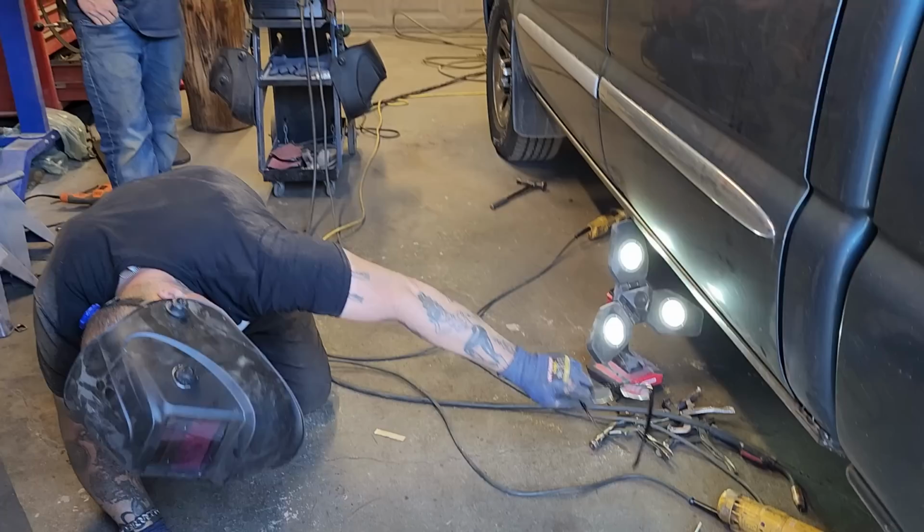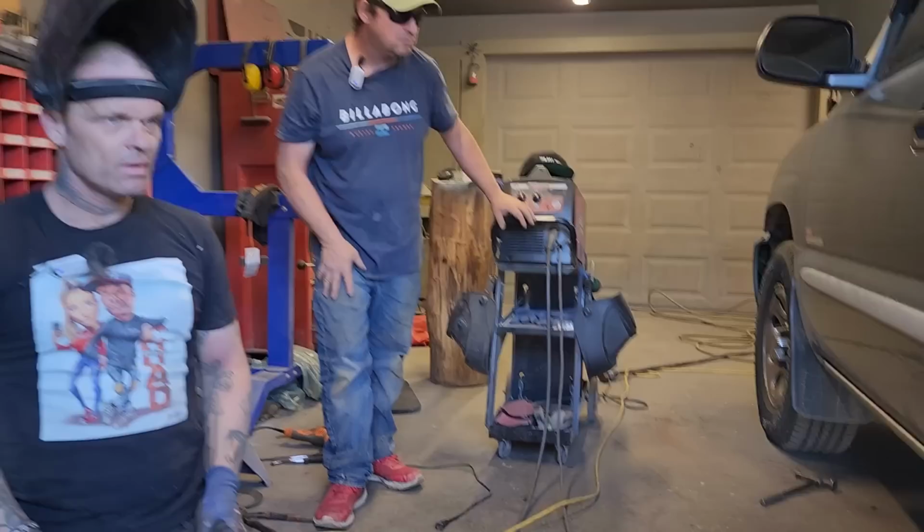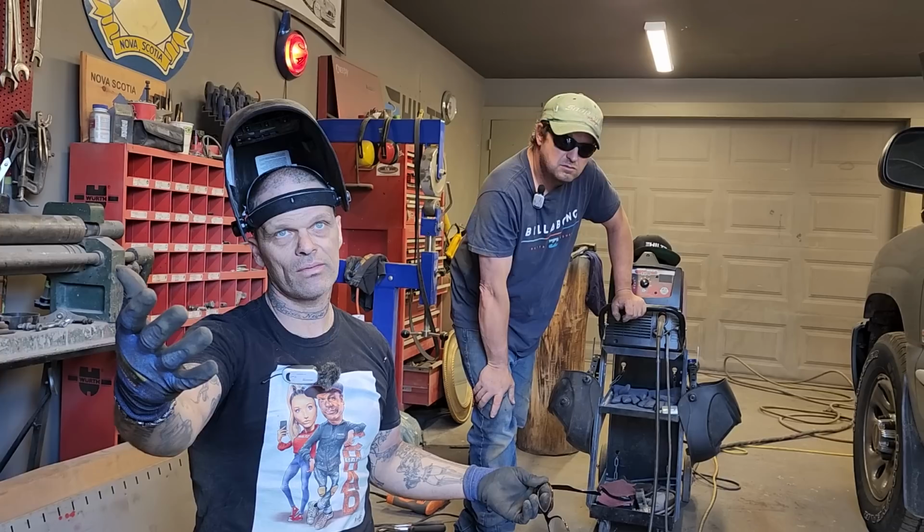The self-tappers on the bottom, I'll go along and weld each one of those, make it look like a spot weld or a plug weld. So it looks like we're doing the right thing. We can grind them off to make them look even better than that. The screw's not coming out. So there you go. There's a sill replacement, cut out and put on, with the time that you have and explaining it. So you can do it just as well as I can do it.